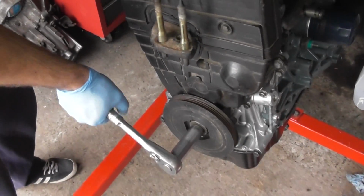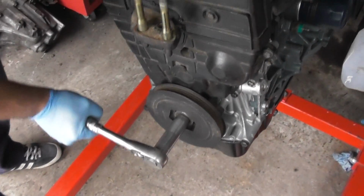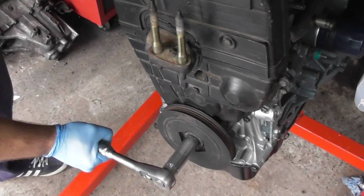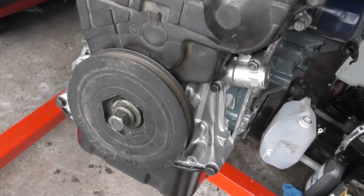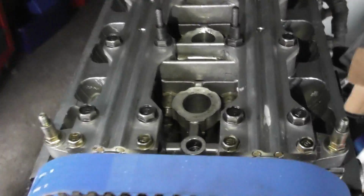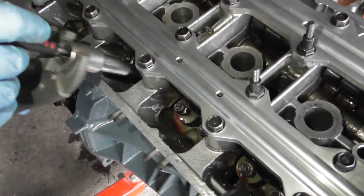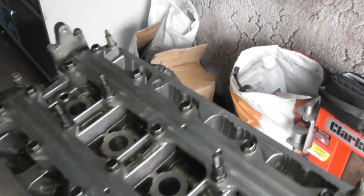Then what I can do is I can rotate the engine over. So here you see this is for cylinder 1. I've got my up mark here, 180 degrees round, always anti-clockwise. So I'm rotating round, rotating round. You see here now this is kind of opposed to my C line. And then I go straight in to looking at number 3. So I do exactly the same process again. Get this on here, loosen it off, and do the same process with the feeler gauge.